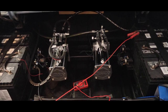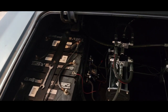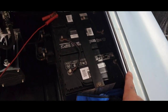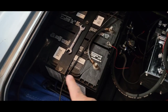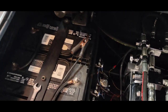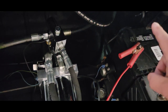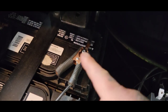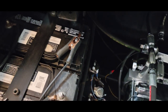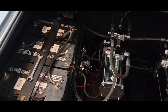This is what works for me — might work differently for others. The batteries are in series. They come around the back to here, and then the hot wire comes in from here into your batteries. That's your start right here. Over here is where your quick disconnect goes — some have it on the trunk, I have it underneath or near the front seat.